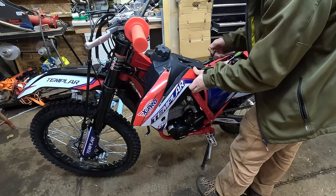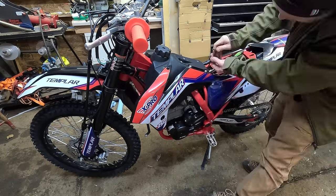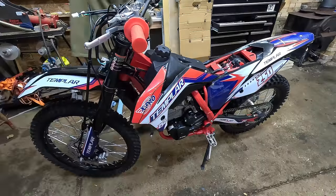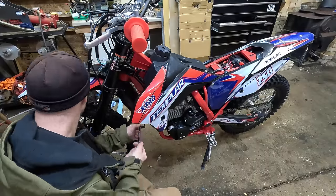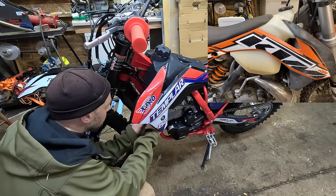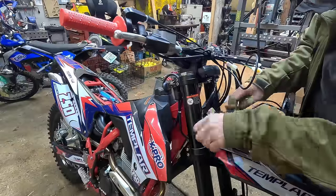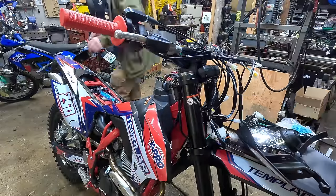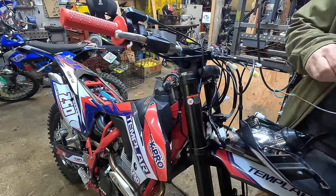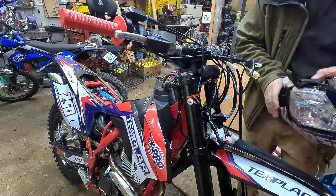The air filter looks just like the one on my 2014 KTM, so I think it will be easy to find. Mounting the stainless hardware into the plastics required a little flexing since they've never been on the bike before. I looked at my XCW plastics and they look like they could bolt on here — the two main bolts under the seat on the tank look like you might have to redrill one, but the plastics were almost identical.